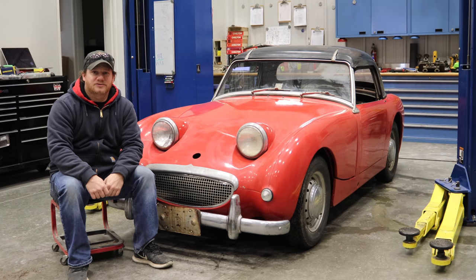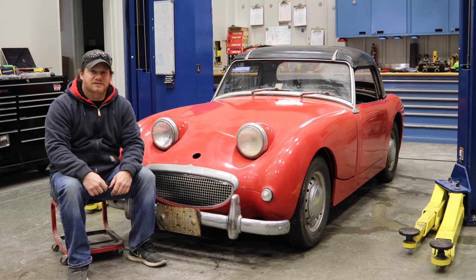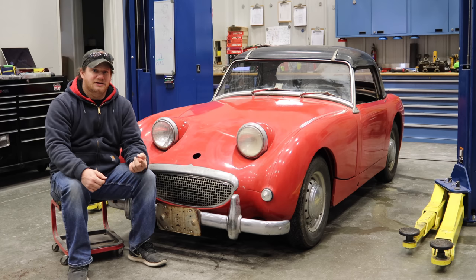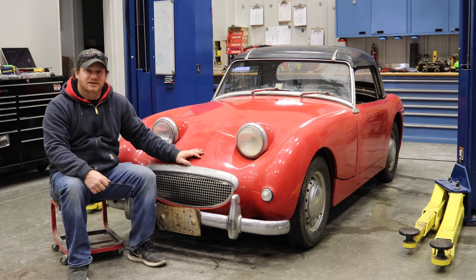Barn Sprite number two is now drivable. It's not really drivable on the road yet, but it does run and drive. I've had to throw some used parts at this car — I put a rear end in, got a drive shaft, and used two screws for the carburetors. As far as new parts, I put in a master cylinder, a slave cylinder for the clutch, all new radiator hoses, and some spark plugs. The ignition system is all as I found it in the barn besides the spark plugs. The carburetors — I haven't thrown any parts at them besides the two screws; all I've done is clean them and put them back on. Hopefully in the next video I'll be finishing this car and getting it ready to sell. If you want to see more videos like this, comment below and click subscribe.